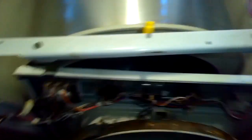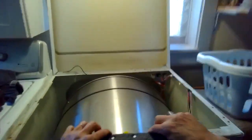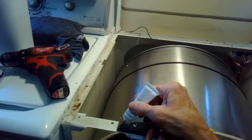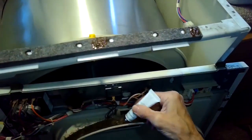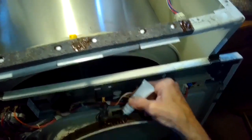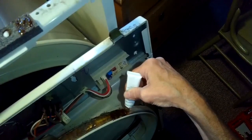Just be patient and keep scraping off the old front bearing. Once it's off, we go ahead and clean up that surface area by scraping some of the old glue off. Now we'll add the contact cement — onto the back part of the felt bearing that comes in contact with the front panel. They give you a pretty big tube; I'd use probably half the tube total — about a quarter of the tube for the felt and about a quarter for the metal surface on the front panel. I use a zigzag pattern, just back and forth.